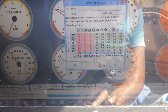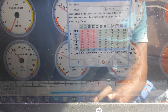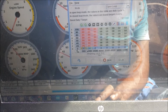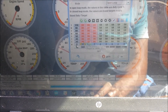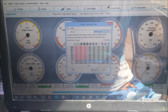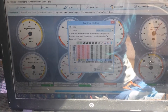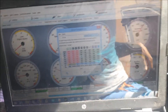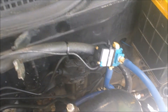So we're going to start the car. With around 800 to 1000 RPM we should have a 50% duty cycle being fed to the solenoid — that's a good way to confirm the solenoid is actually working. The car is running at about 700 RPM. I can hear the solenoid being pulsed. Let's go to the engine bay and hopefully get a clip of that so you guys can hear it too.